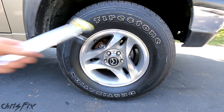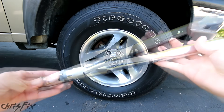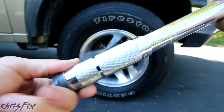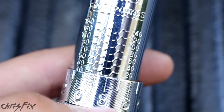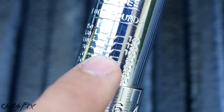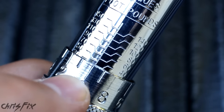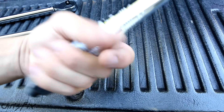Anyway, get your click adjustable torque wrench, which is the most common type of torque wrench and what we're talking about in this video. To adjust the torque wrench, the first thing you do is go down to the end here and loosen this little knob, and that allows the handle to freely move back and forth. Now you want to make sure you're using the correct units. In this case we're using foot pounds, but if we go to the other side of this wrench, you can see there are different units, because not everybody uses foot pounds. Then we're going to look for a hundred, because our torque is a hundred foot pounds. You can see right there we have a hundred foot pounds. So we're going to rotate this until our zero right here meets that hundred foot pound line. So now we're going to just turn this handle until that zero mark lines up with the hundred mark.